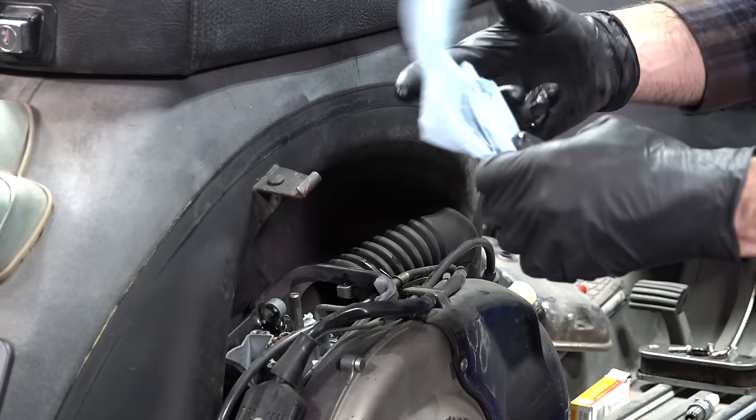Since I flushed out the fuel line, the carburetor bowl is getting a nice fresh shot. I'm watching the carburetor to make sure if the fuel isn't overflowing — if the needle's not working, it'll be dribbling down. I also check these caps with new gaskets to make sure they're not weeping any gas, because that will cause your Vespa to become flooded easily. Let's turn on the choke — and oh yeah! It started. That's pretty normal — it's going to be pretty smoky. I have the choke off now and it's already at a pretty good idle. The headlights are working, both high beam and low beam, running off the alternating current of the flywheel. But there's no brake light or tail light, so we'll need to put a battery in next.